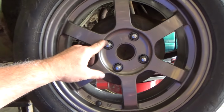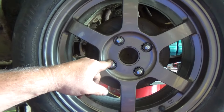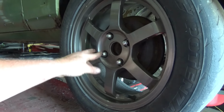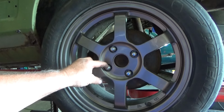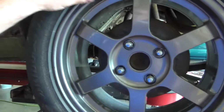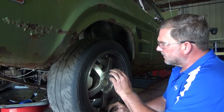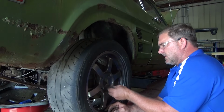I have really good lug nut contact with these deep ones. These were actually Jeep CJ lugs, and they're full depth threaded and capped, so they look nice, but the studs protrude all the way through these right up to about there, which is nice. Much better setup. Now I actually feel like I can drive this thing down the road without the wheels falling off. You can see I have really good protrusion of the lug stud now, so that was the goal.